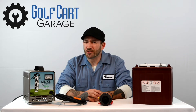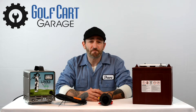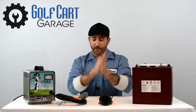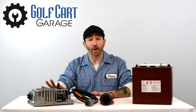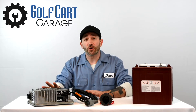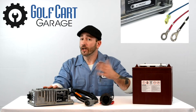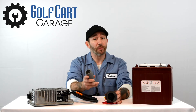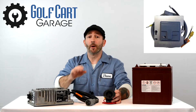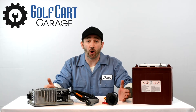Wouldn't it be great if someone designed a charger that has its own advanced computer inside of it that could charge your 48-volt Club Car without worrying about the OBC on your cart? Here at GolfCartGarage.com we recommend the Lester Summit II model charger for use on a 48-volt Club Car. The Summit II can connect and charge to these carts in two different ways. This type of charger comes factory standard with wires to connect to your first and last batteries, so that it bypasses your Club Car OBC just by installing it, because it doesn't go through the cart receptacle before the batteries. It can also be equipped with this round 3-pin plug, but if there's an OBC installed, it would also require a bypass kit to be installed on the cart around that computer.